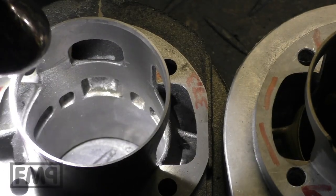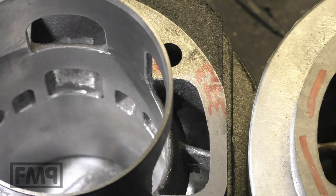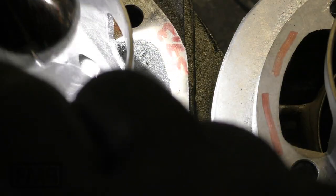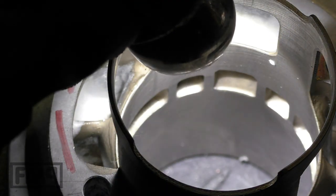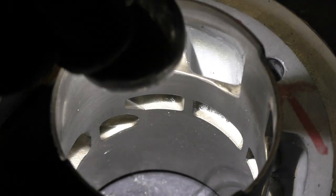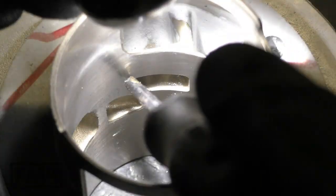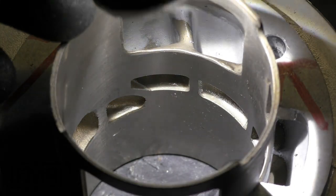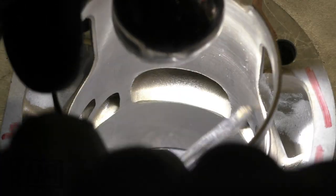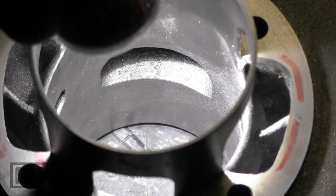If you look inside here, this window is bigger, this one's smaller - they are also not as wide. What about transfer port outlets? That's the SuperG and Stelvio. This one looks different - this is also wider, it's definitely bigger: 4-5mm bigger transfer ports. And with the exhaust port, we have side exhaust channels here that we don't have with the SuperG.